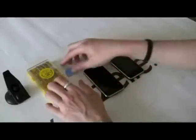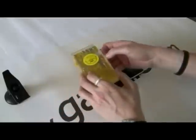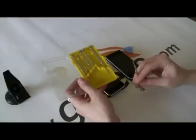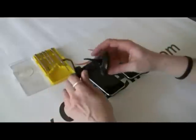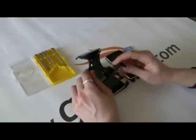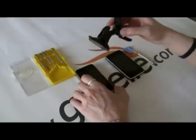The tools you'll need for this are some kind of prying device just to get the plug ribbons out, one small Phillips head screwdriver — preferably something with a magnetic tip so you don't lose the screws — and here's the secret: one suction cup. I got this from an old GPS unit, and this will be used to pull the screen off, which is far easier than prying it, as you've seen in previous videos.